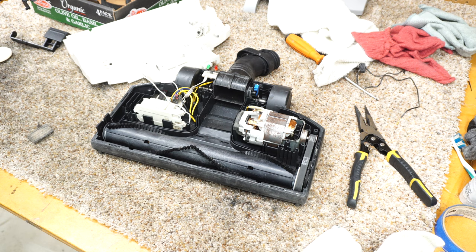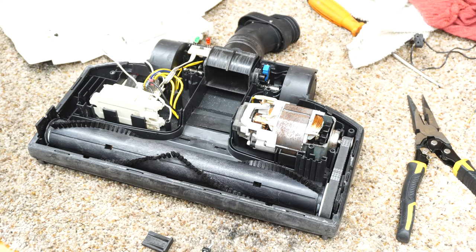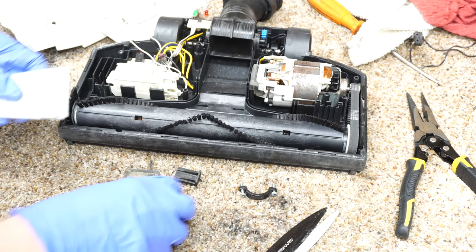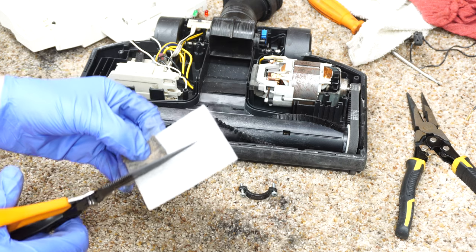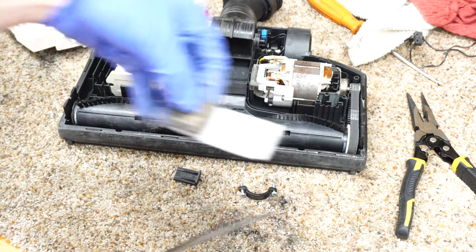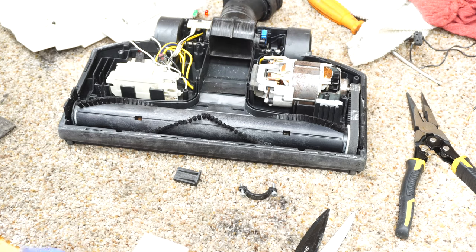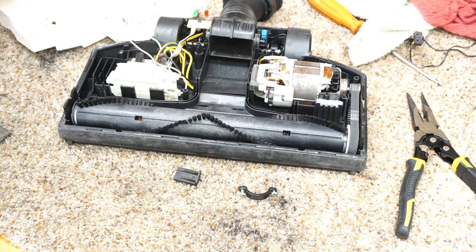There are some things here that are very important when we put this together. These guys — super important in this thing. This was the filter that was here. I have a little life hack with that. These filters are made out of the same material that Miele uses, and if you're servicing Mieles, you always have these little cutoffs that don't fit anything. I always save the cutoff material just to make these little filters. You don't want to use felt — you want to use actual filter material. In this case I even have German filter material for the German power head. The motor breathes through there. That's just a little tip in terms of maintaining filters.